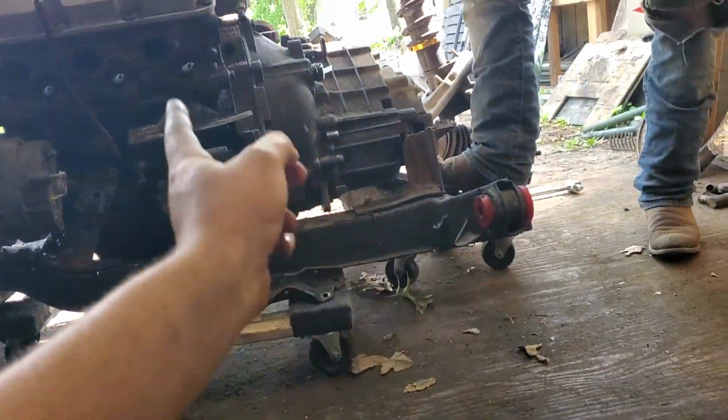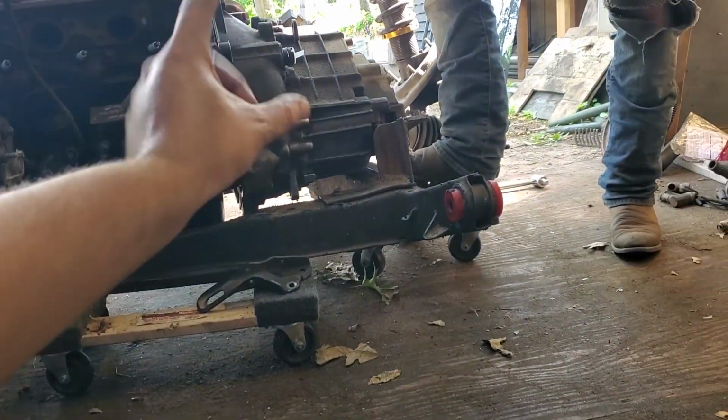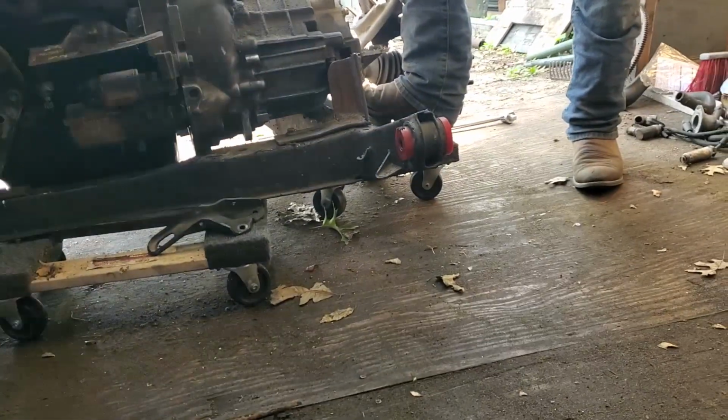Kind of poop on my pants. Really don't want to have to pull that transmission off. So the main thing is you're supposed to measure, and I didn't. So it should be fine. It's a ZZP 1/4 inch spacer in there, bolted in with the hydraulic throw bearing. And then we have, obviously, this. So it should be fine, and it's a Spec 3 Plus clutch. It's been done before. Should be fine.